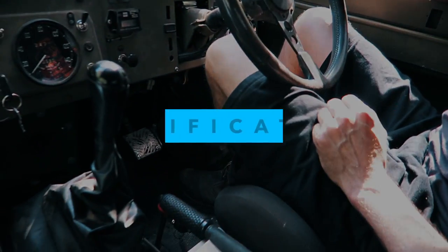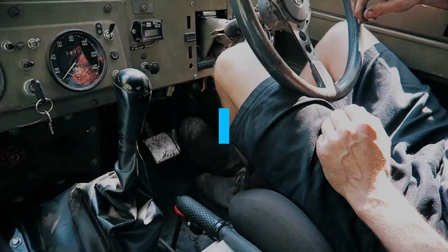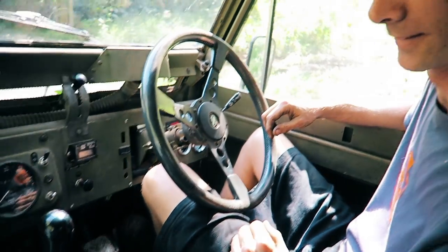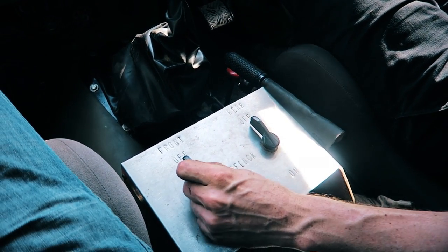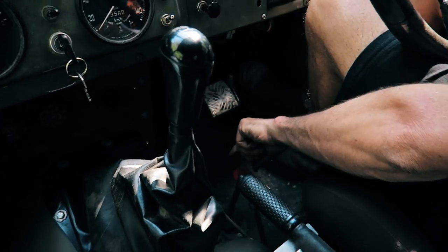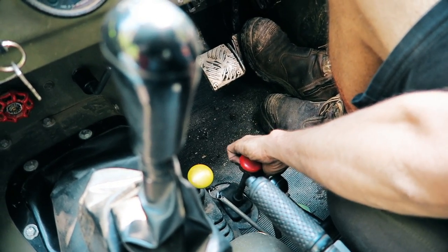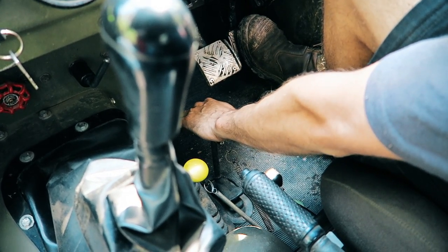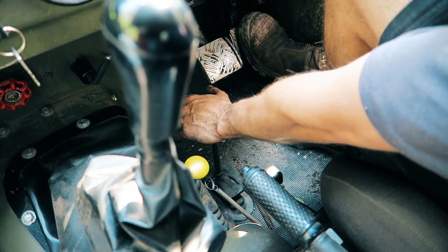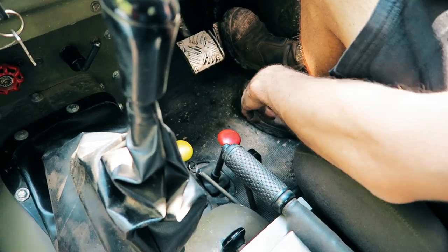It's a pretty nifty system Eric set up to check whether everything is good after he's done some gnarly stuff. You make sure your front diff locks out, rear diff locks out, and your center diff is locked in. While driving, you take the load off and push it against the spring. If you keep driving with the center diff locked out, you know you've got drive to each corner, then the spring pulls it back in and you can keep playing.